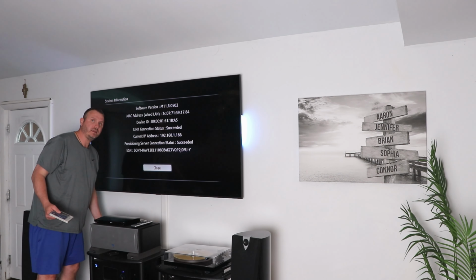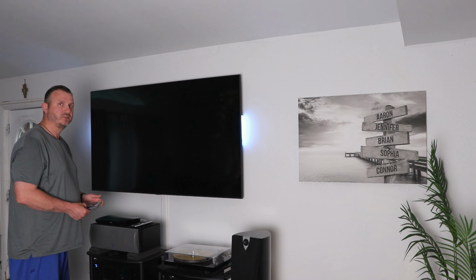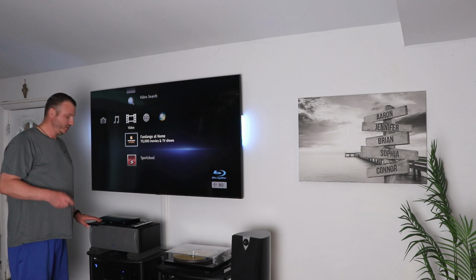All right, the first thing you do to get started is you want to start with a clean slate. So after every SACD, the whole thing needs to be shut down on the BluRay player and rebooted. So I'm going to start clean here just to show you how the steps proceed. First I unplug the BluRay player and then plug it back in. Once it turns on, eject the disk tray. Put your disk in the disk tray, but do not shut the disk tray.